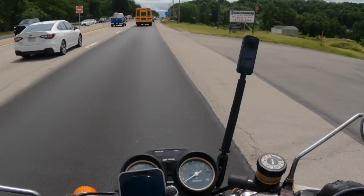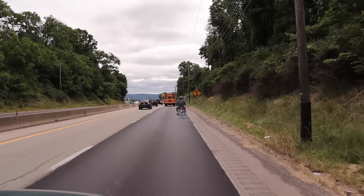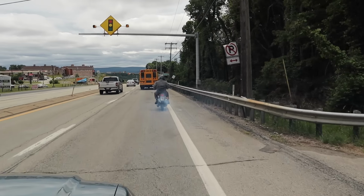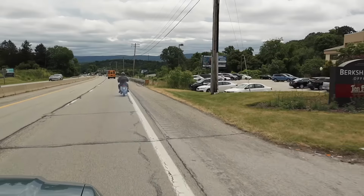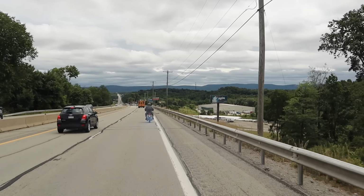I am definitely losing power. Come on. Greg, that smells great. Uh-oh. Maybe you just need to burn some more oil off. I don't know. It feels almost like it's getting a little tight in the motor. It kind of feels like I'm down a cylinder. Let's find a spot to pull in. Maybe we'll check spark plugs, see if that'll tell us something.